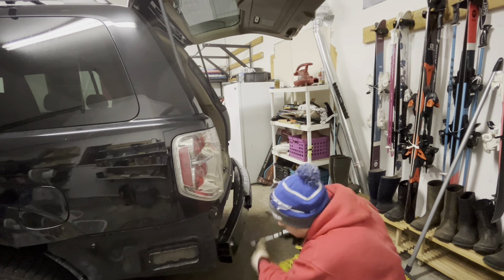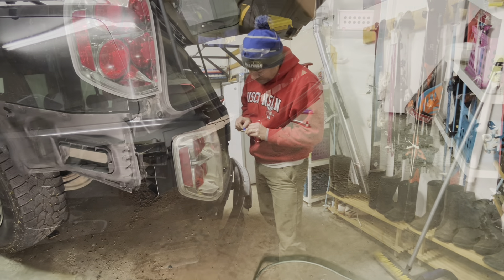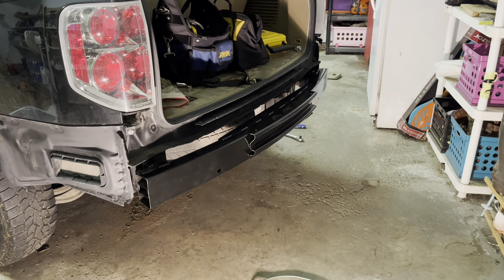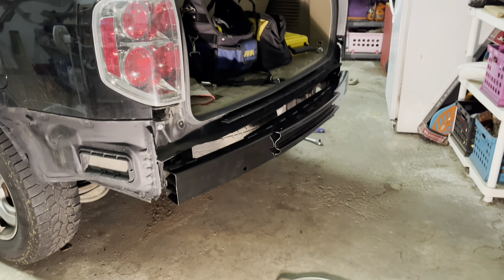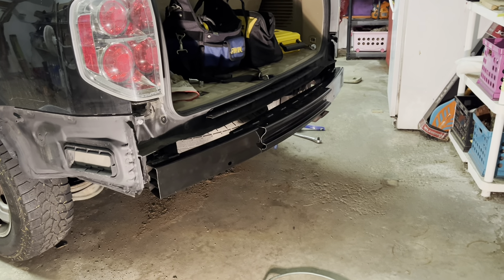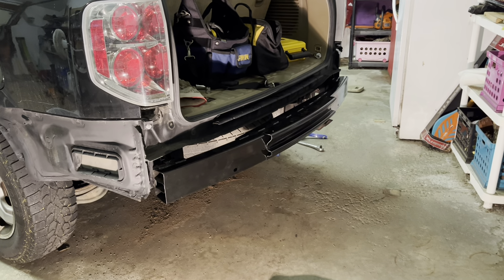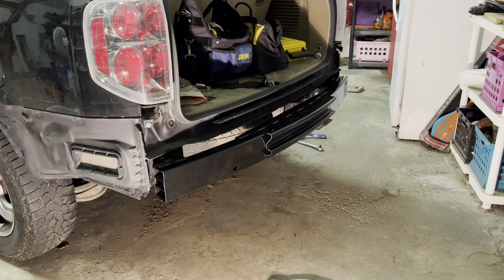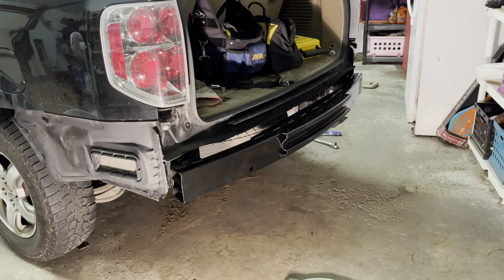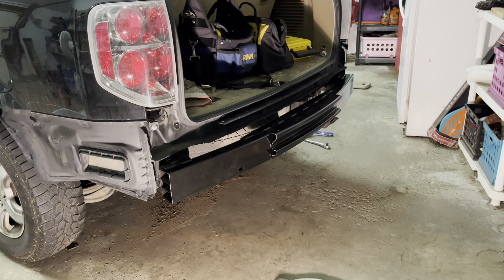I'm going to put a little thread lock on the bottom bolts. We've got the new bumper on, secured with the four bolts with a little thread lock added. I put some Rust-Oleum around the rust spots that were exposed once I pulled the rear bumper and old reinforcement off. Now all that's left is wiping down the plastic bumper housing, placing it back on, and putting all those screws and the three 10mm bolts back in place.